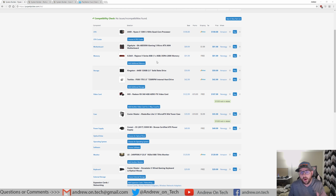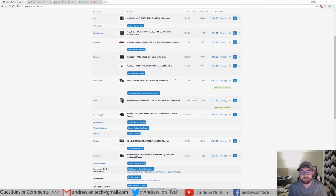And since it's one 8 gigabyte stick, the nice thing is in the future, if he ever needs to upgrade to 16 gigabytes, he can just, boom, buy another 8 gigabyte stick, throw it in there, bam, now you've got 16 gigabytes. You probably lose a small amount of speed by going single channel versus dual channel, but it's not going to be really noticeable on this type of build, so I wouldn't worry about it too much.